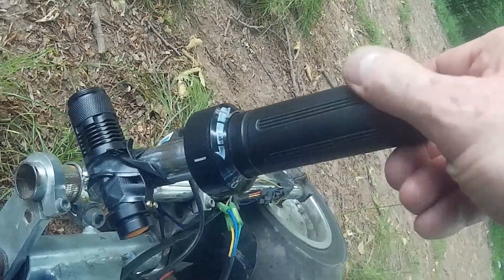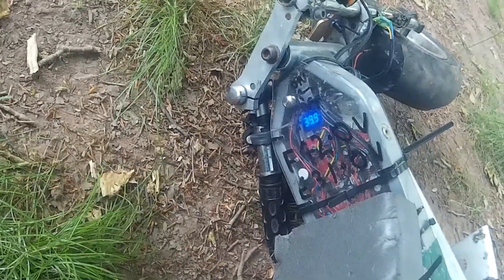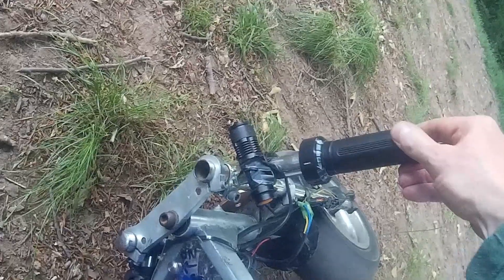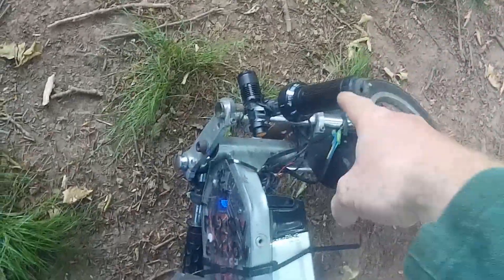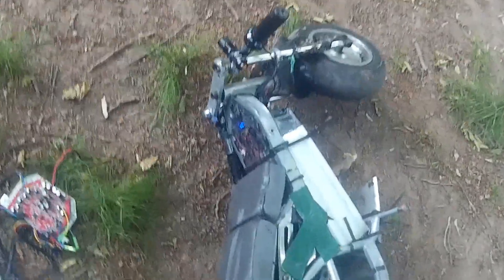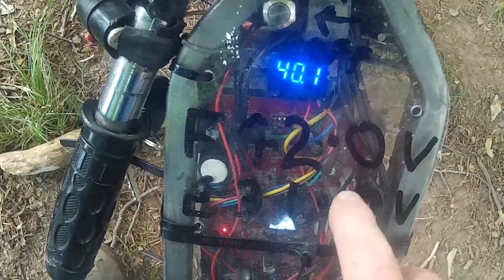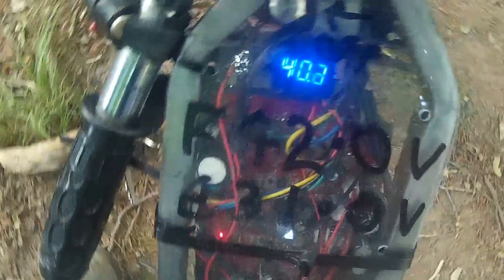In this case, I've connected it to a standard electric bicycle twist grip. I had to put some level-shift resistors in, and then I had to alter the code so it would go from zero to full speed on the voltage that comes out of the twist grip. On this particular mini moto, quite conveniently, it fits really well between the chassis parts, and I've got a bit of perspex on the top and a bit underneath, just to show it off a bit.